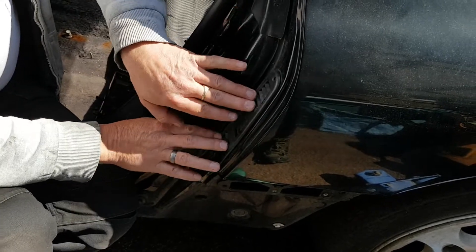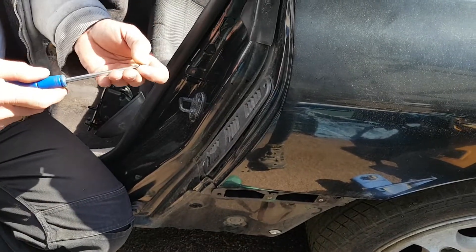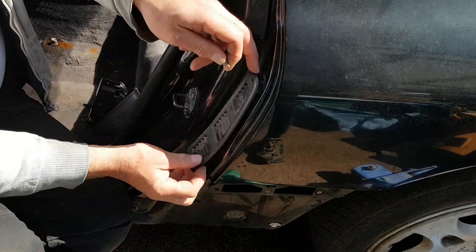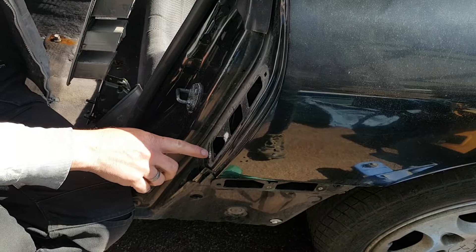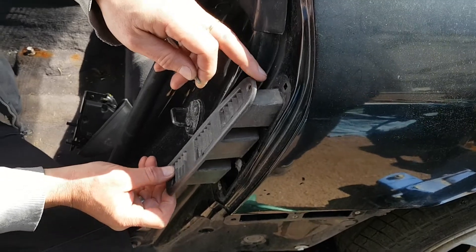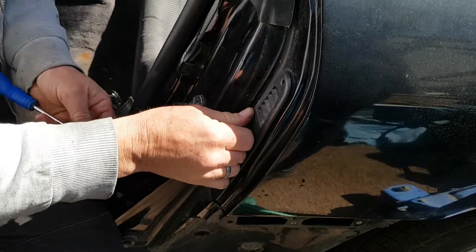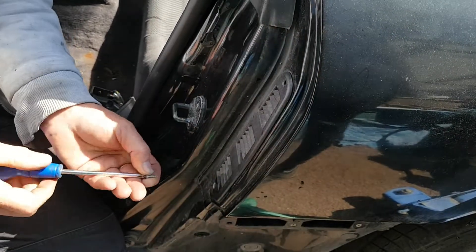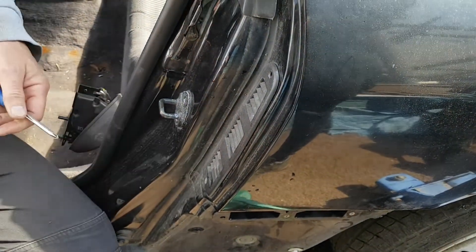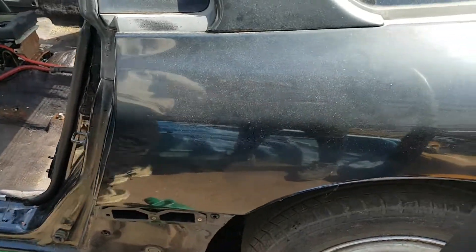You don't actually need much water to give you a major problem, so replace your foam or use a mastic, PU sealant, bituminous rubber, or anything that's going to give you a really tight water seal around there. I'm going to take all of these problems in hand when we put this car back together. I've also just noticed there should be a little screw plug up there but it's missing as well, so that's another thing needing replacing. It's really weird how time has given these cars so many problems, but if you look at each one individually they are such tiny problems and just involve a little bit of maintenance.